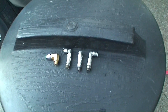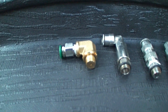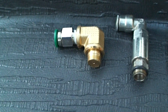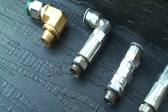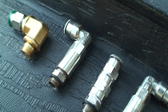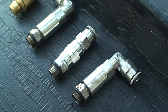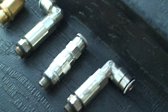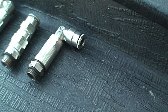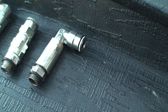Got another comparison video for y'all today. We're looking at methanol injection nozzles. First we have a B-Cool nozzle off eBay — 1000cc or 15.5 gallon per hour. Next is a 14 gallon per hour Devil's Own nozzle, rated about 880cc. Then a Cooling Mist CM10 nozzle, 10 gallon per hour, rated 800cc at higher pressure but in reality closer to 700-something cc. Last is a 7 gallon per hour Devil's Own nozzle, about 550cc.